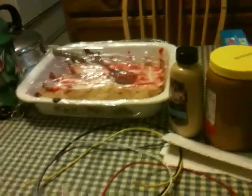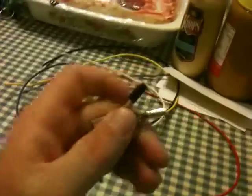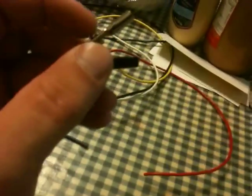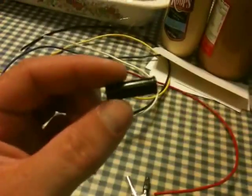What we're gonna do is strip off each end about half to three-quarters of an inch so we got enough bare wire, and then we're gonna feed it up through the end of this thing through a little loop-de-loop — you can kind of see it there — and have it come out again and then get tightened down at the screw, and then it will have one end done.